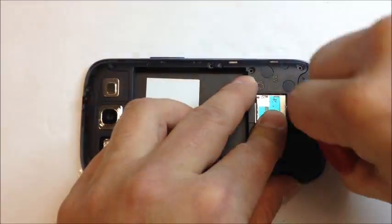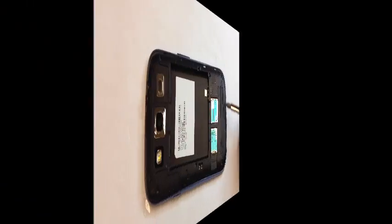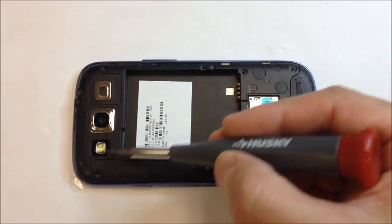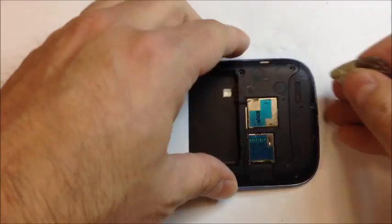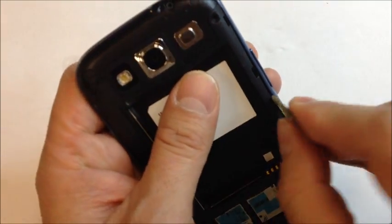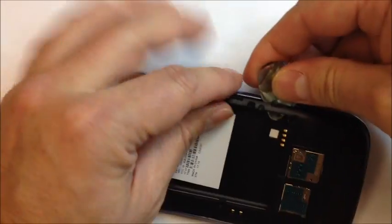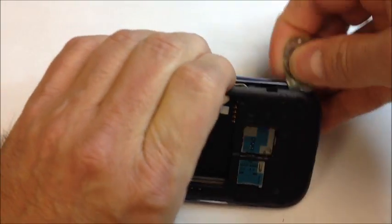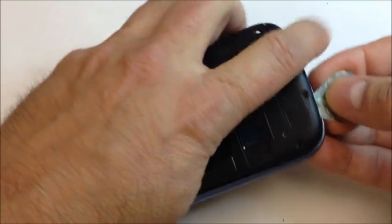Those two bottom ones are a little tricky — you might have to pry underneath them while you're removing them. Once you get these out, there's a sweet spot you can pry under just around where the volume buttons are located. Starting at the bottom doesn't work out too well, but if you go along the side here — it's a very thin piece along the side — it's pretty easy to get under. From there you can work your way around the bottom and unhinge it from the clips.